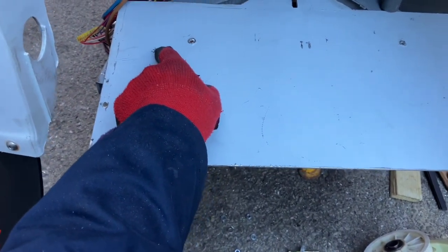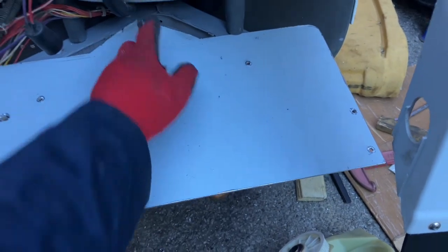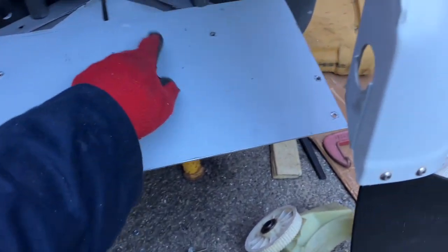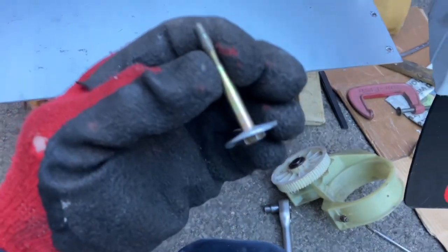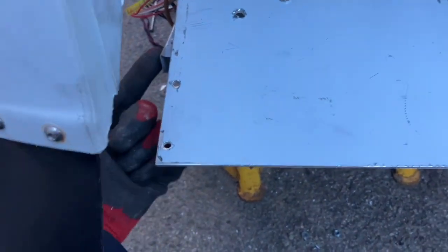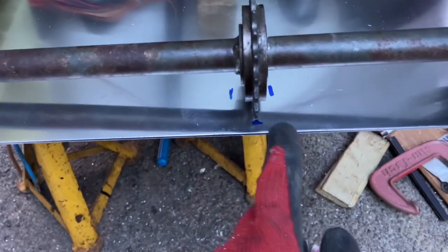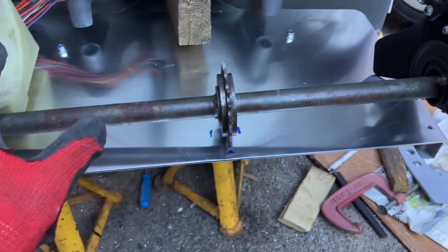It installs nicely. I've gone for a slightly larger hole here — when it clamps down it bends ever so slightly because the chassis tilts downwards, and this part here is also bent up slightly. I put it into position, clamped it on the sides, and from underneath drilled the holes and put bolts through, which pulled it into shape. Once in position I was able to drill from underneath through the chassis on both sides. The plate looks really good — I've just marked it up roughly and I'll square it up and cut that piece out.